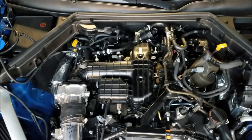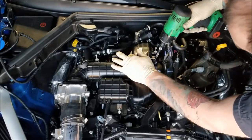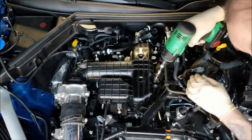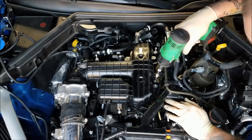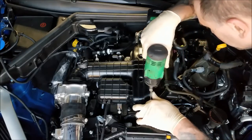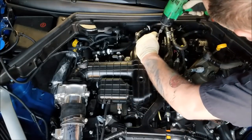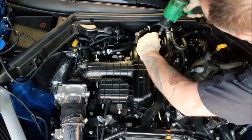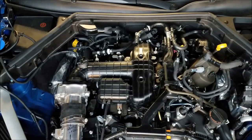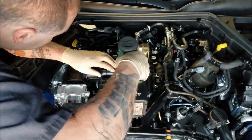Normally when you tighten things down, you want to start from the inside, work your way out. So, you go right here. Again, make sure you got nothing pinching that down. These are reasonably small bolts. If you're going to go through, torque them down. Probably torque them down to 15 foot-pounds, you know, 12 to 15 foot-pounds, getting them torqued down. Come inside of here. We left these ones in.